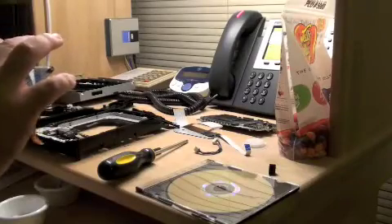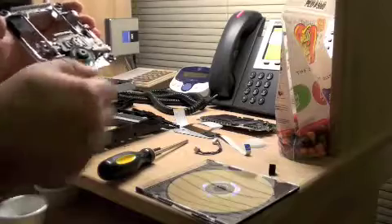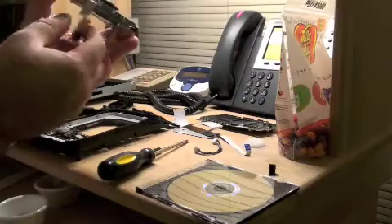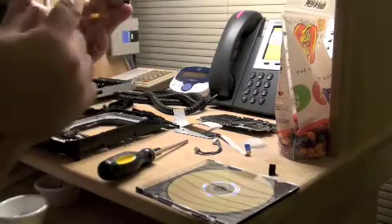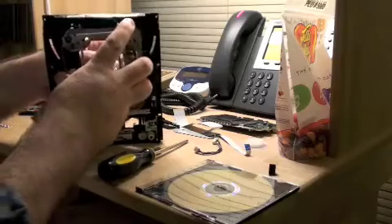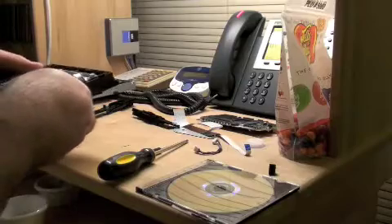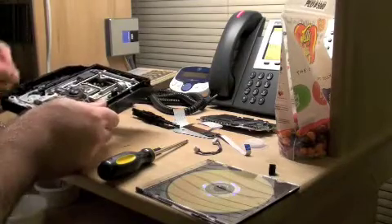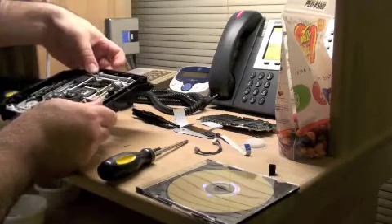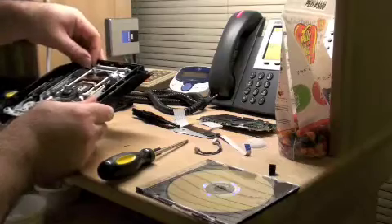Dress up your mechanism. Make sure you put your rubber shock absorbers in. Your cable that goes to the spindle motor — make sure it's put on the right way. Carefully thread your ribbon cables through and work on it to get it positioned. Loosely put a couple of the screws back in the transport so that you can align the ribbon cables if you need to.